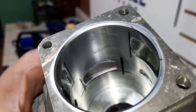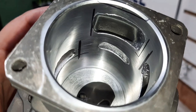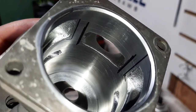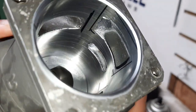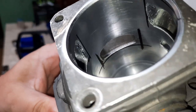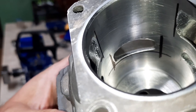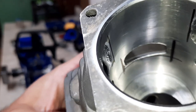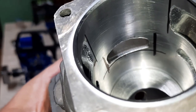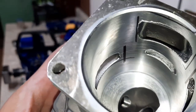Here's a look at the layout. These are just 65% port widths. Opening up the lowers to match the piston, same thing with the intake — take it to about 65%. The exhaust will end up going wider because the piston I swapped allows for it. The stock piston won't let you get much wider than 65%, which is pretty much maxed on a stock piston for the Stihl. So I'll get this roughed in.